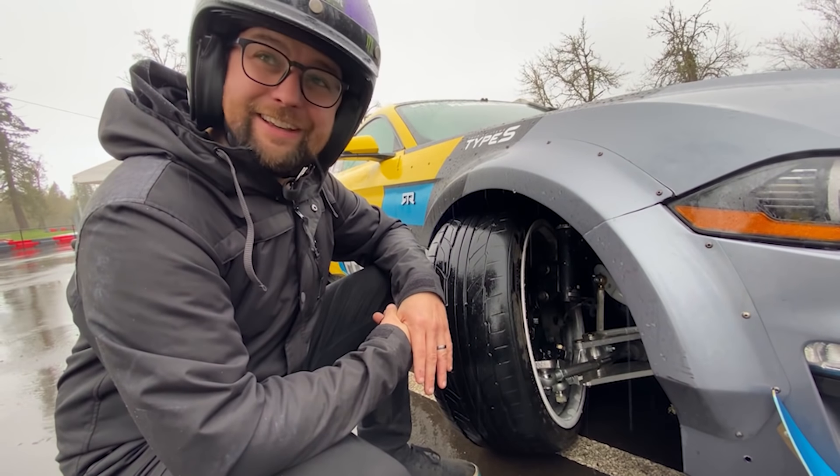I can't believe it out of the box on the first go. Since this is like a Craigslist EcoBoost S550 - yeah, because these are less than 10 grand now - and even with a V8 you can get them pretty cheap and they make gobs of power. For what it is it's such an amazing car. There's been a gap for someone who drifted for a long time in an S-chassis or BMW - when they go to the Mustang they're deterred by the steering feel. I think this kind of bridges the gap. You still have to help it since it's electric steering, but it does naturally want to do the work for you. We'll mess with the caster and control arm angle and I think we can get even more self-steer. Mounting the sway bar to the strut would add even more, giving it leverage to pull the wheel back to center.